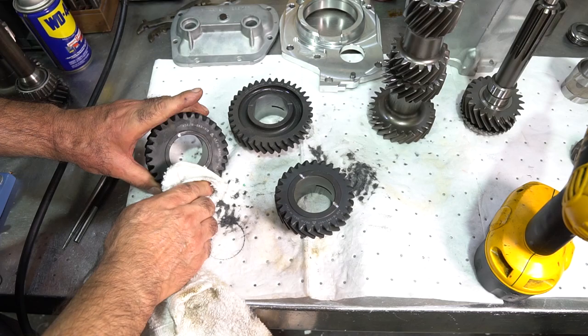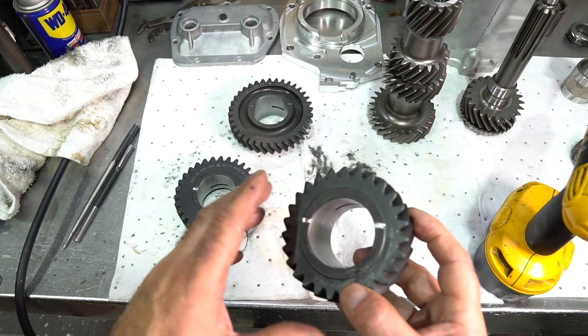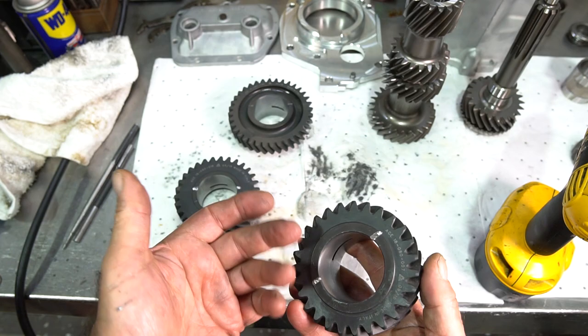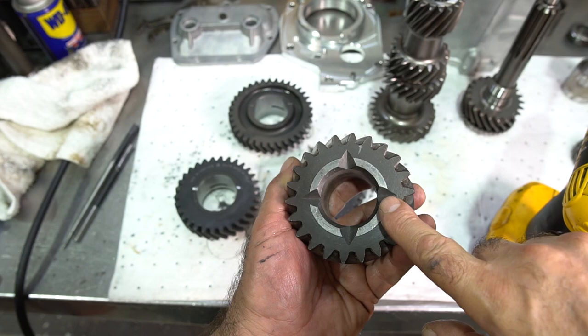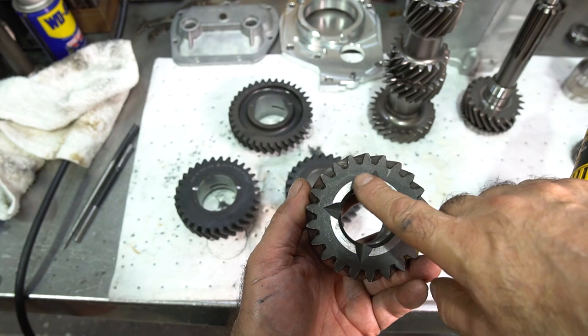You can see what I did there — it's no big deal. You just want to have a way for the oil to come through the gear so it can exhaust somewhere. If you don't have a place for it to exhaust, it's going to be a problem. Here's a Super T10 third speed gear — look what they did: they've even put oil reliefs on the cone side of the gear as well as four reliefs on the thrust surface on the back side. That's a smart thing to do. If you're doing a transmission and it doesn't have oil reliefs on both sides, you want to put them there — at least put two on there.